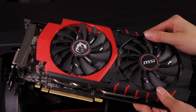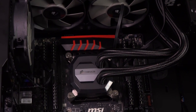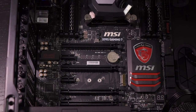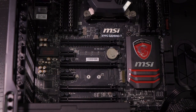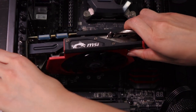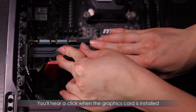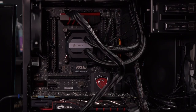I'm going to install the graphics card so I can do a quick test boot before I wire all the cables and plug in the drives. Remove these two expansion slots — they're metal, wish all cases were mostly metal. I'm installing the card in this slot because installing it higher would get in the way of the DIMMs. Bring the card in, slot it carefully, match up the points, and seat it until you hear a snap — meaning it's good to go.